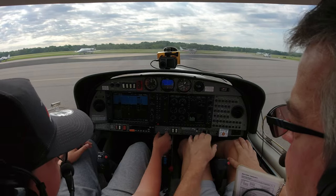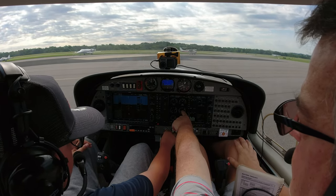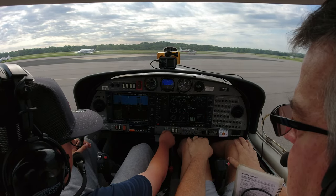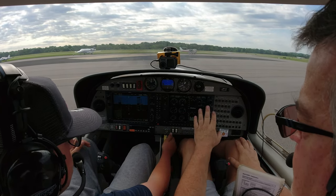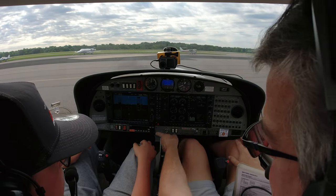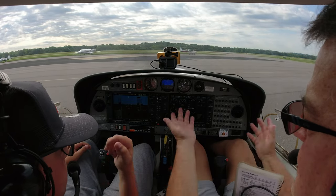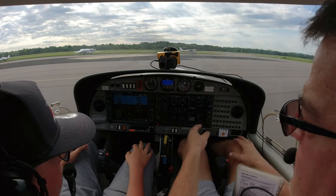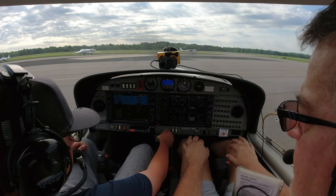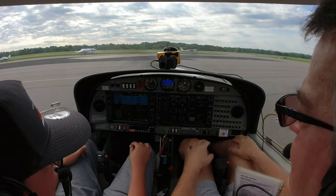Take the key and go one click to the left. We're going to watch right here — that's about 150. Go one click back to the right to both. Give it a second. Now go two clicks to the left. That's 150-160, so that's within our range. Now take her two clicks back to both. We have to be careful going to both because we don't want to hit start — that will mess up the starter.